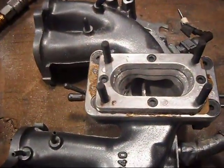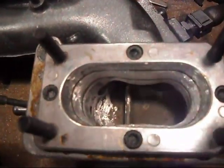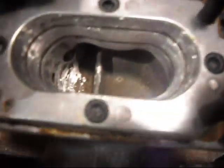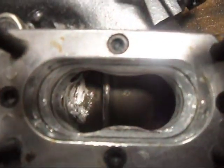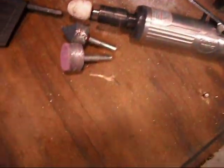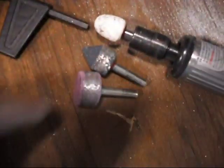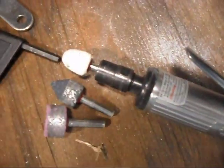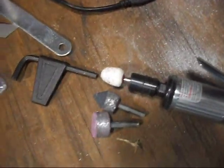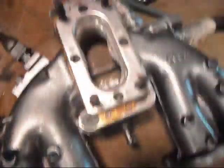I'm going to show you I've been doing a little bit of porting, trying to get these three different layers to contour together pretty good. Working on this side, starting to taper back over here — I'd like to get a nice square oval at the bottom. I'll make sure all three places are pretty smooth. Like anybody else, you're probably going to go out and buy the cheesy Harbor Freight tool set. What I've found is only the white one cuts the aluminum good. The other ones clawed up real good and they just don't work. The white ones seem to break off — they're softer and you're actually able to do a little bit with them. I wish I had a little carbide ball, but working with what I got.